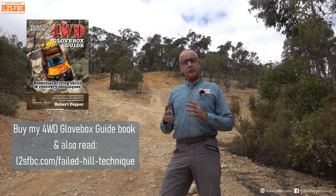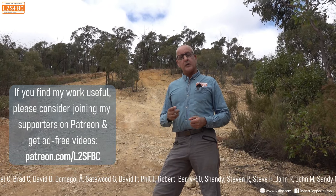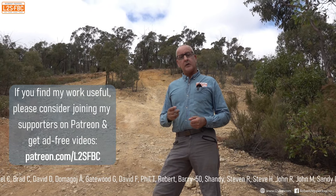I'm going to put that process on my website as well. The important thing if you drive a manual vehicle is to practice this in a safe situation before you actually need it, because when you need it your adrenaline will be high, your emotions will be up, you'll be worried. You've got to practice it till it's essentially second nature. Also, some vehicles have an interlock so you cannot start the car in gear — if your vehicle is one of those, you need to know about that. You might also find it will only start in gear in low range, not high range, so don't assume.